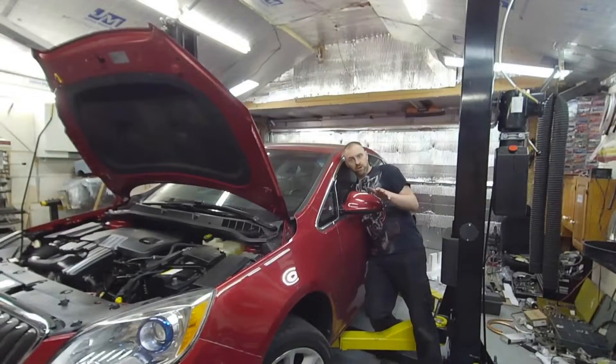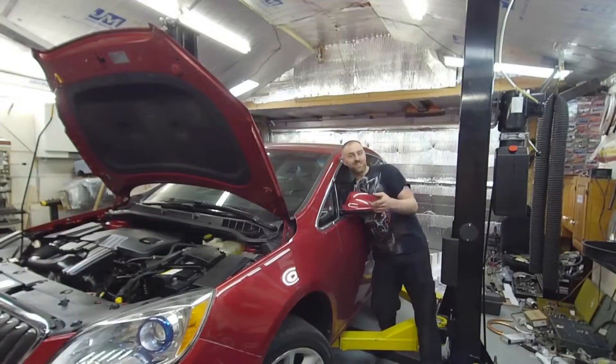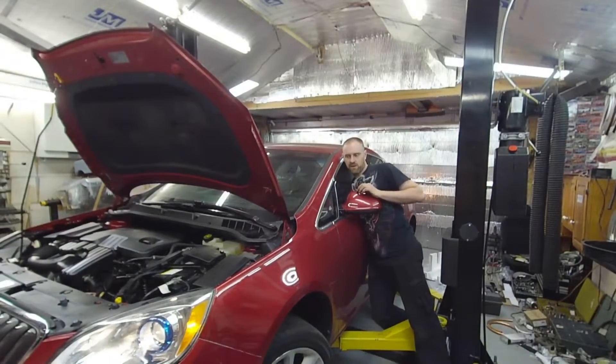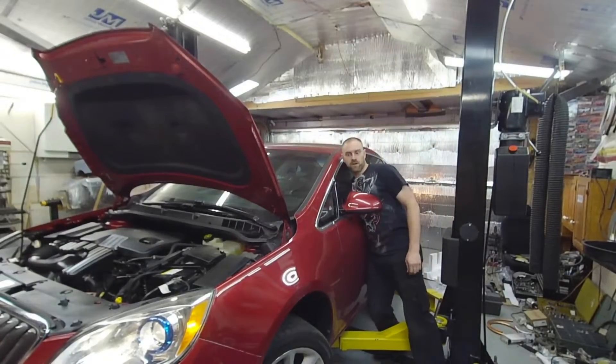The first part of starting the car, since the fuel system was dry, is I'm going to prime the pump — I'm just going to turn the key to the on position. But I have a disconnected battery. See what I told you about forgetting to connect something? I forgot one of the most important things — the battery. That's one of those simple things I forget a lot. There we go. Now I've got a fuel pump priming. So I'm going to shut the key off again, pull it out, reset everything, and then I'm going to redo it again — prime it and then try and start it.